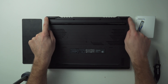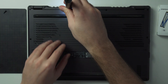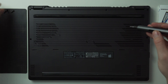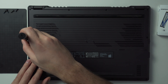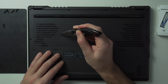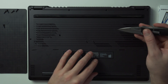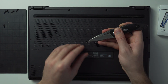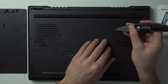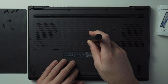If you look at the back of the computer, you'll see you need to remove 13 different screws. All but three are simple — just use a Phillips head screwdriver to torque them out. I like to use my WowStick automatic screwdriver, but be careful not to over-torque, especially when putting them back. The three screws in the middle have little plastic covers with adhesive on the bottom, so you'll need something like a knife or straight edge to lift those out. Once all the screws are out, pull up on the plastic cover to reveal the internals of your G15.